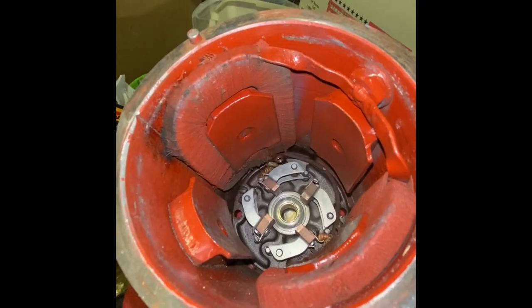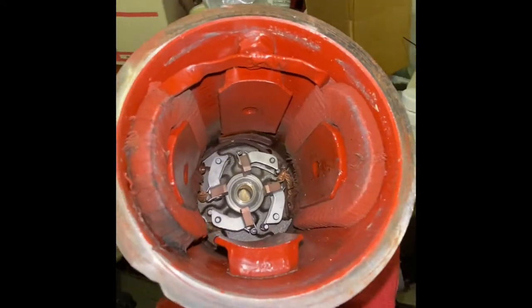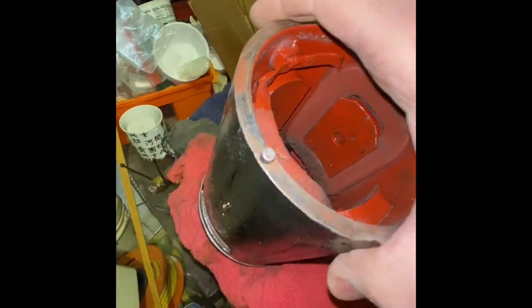I removed the drive housing and armature and found that they replaced the brushes and painted the interior with a red varnish. It appears one of the windings is shorted out on the housing. The suspect windings are held in place with steel blocks that are attached by a large flathead screw on the outside.